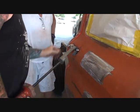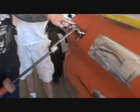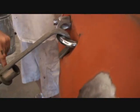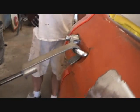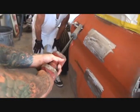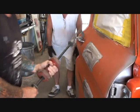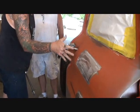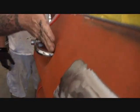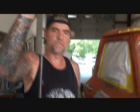What do you see in there? It's working. I'm not really looking at the dent — what I'm looking at is this body line. Can you see that, Dylan? It's coming out right here. I don't want to pull too much where this body line gets distorted. I think we got it — look at how the door handle looks nice and straight instead of caved in. Someone shut that door a little hard. You can put that away, thank you Dylan.